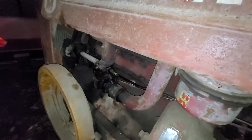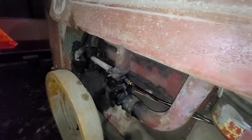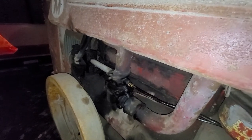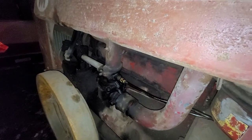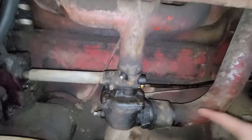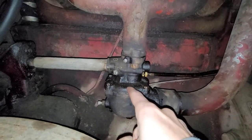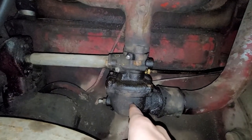The way that carb works — we're going to turn on the fuel — there's a vacuum in the motor, obviously, when you have compression. So it's pulling that fuel up into the manifold and up into the engine. The fuel is starting to leak, which means my fuel is on. The air goes in here and up. It's kind of like an L inside the carburetor, and right down here at the bottom it gets put into the cylinder.